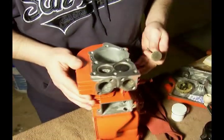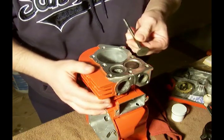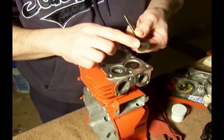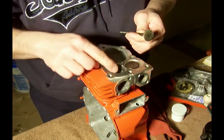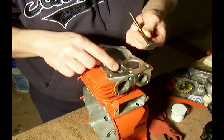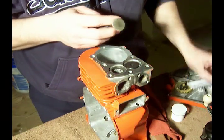One of the things I want to do now is to show you how to lap your valves. The purpose of lapping the valves is to make sure that the edge of the valve seats tightly around the edge. In time, those seats aren't such a good seal.